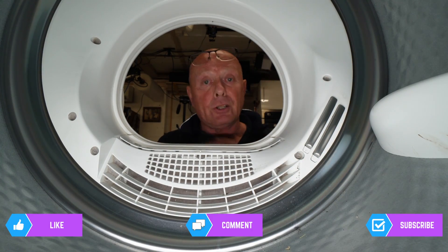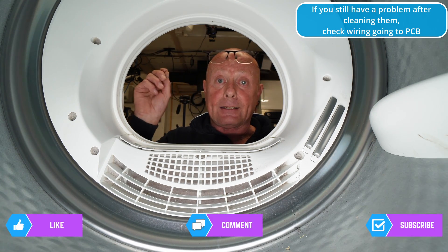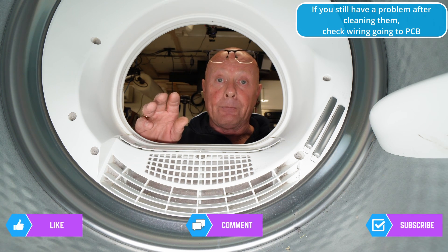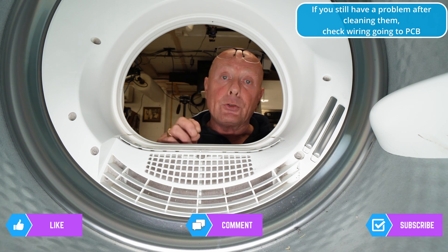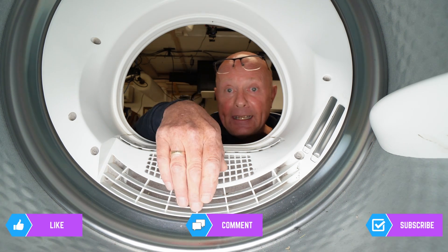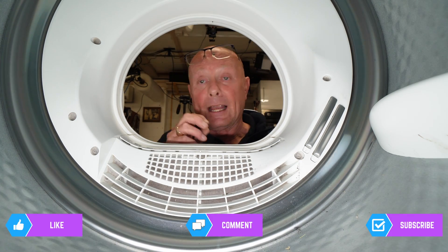Clean both bars. Once the computer is getting the correct resistance values, it will dry for a longer period of time until the moisture level has changed to the correct amount that the program is set at. Then it will shut off the heating system and allow the dryer to do its last five to ten minutes cooling down period. This applies to vented tumble dryers, condensing tumble dryers, and heat pump tumble dryers that have these bars. Some other manufacturers use a different circuit — they may have a sensor in the airflow which measures the moisture in the air there. But a lot of manufacturers use this bar system, and cleaning it will rectify the problem for you.